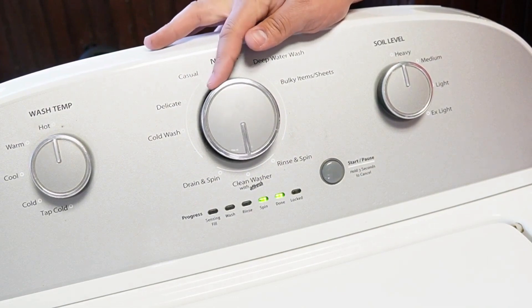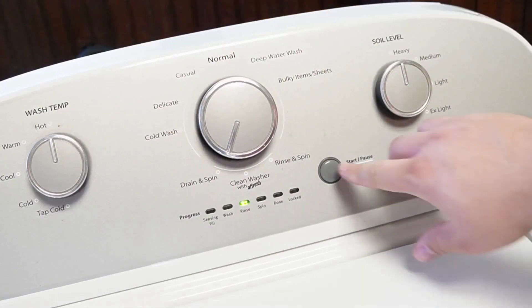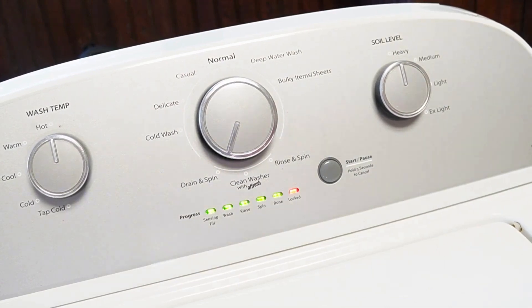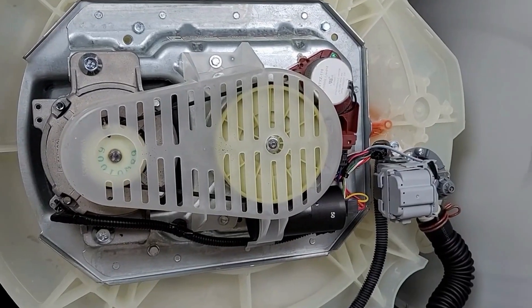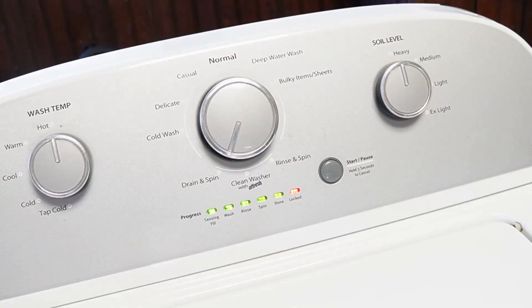Once you're in this mode, turn the knob clockwise four times. The rinse light should be the only one illuminated solidly by itself — this is the recalibration mode. Once you press the start button on the rinse mode, the door lid will lock and it will begin a series of tests and operations on your washing machine. All these tests take approximately three minutes. As the recalibration mode runs, every part and process on this washing machine is going to be run and the machine will physically reset all the components to a default state, allowing them to run at an optimal level. This is a must-have when parts aren't working right or the machine just doesn't know what state it's in, like when you've replaced the shift actuator or even a control board.